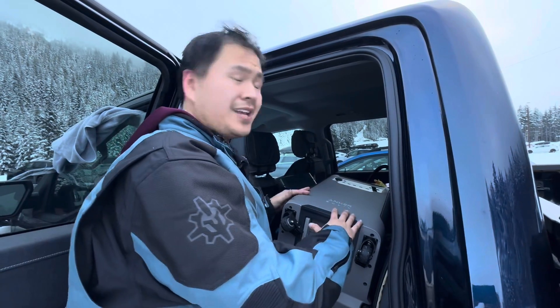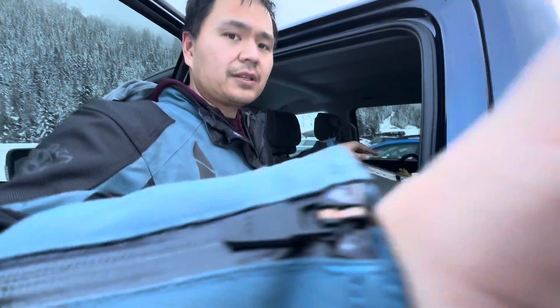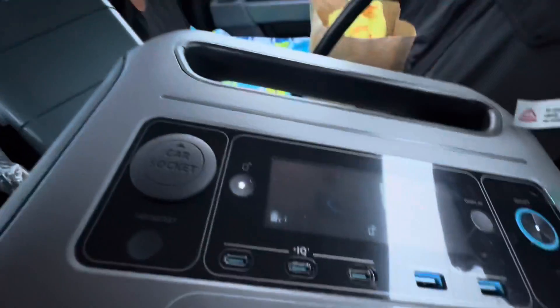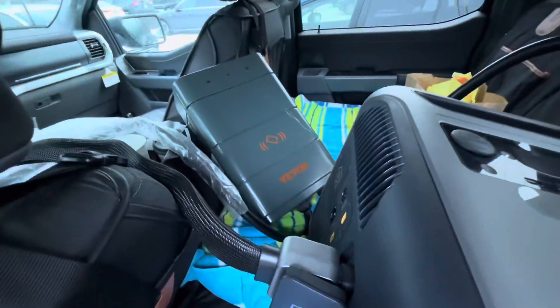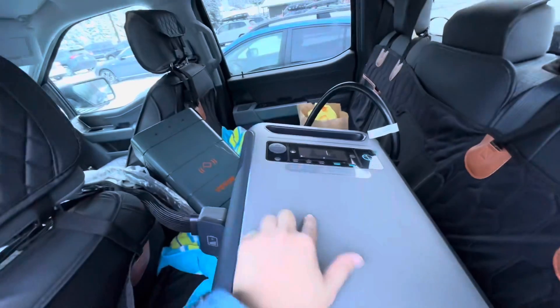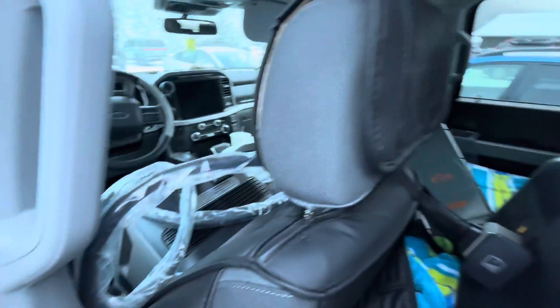I lost 12 miles driving this truck up to Crystal Mountain Resort in the PNW. This setup with the Anker Solix gave me 12 miles back. I was able to drive two hours there and two hours back without stopping at a public charger. Public charging costs about 50 cents per kilowatt at many stations versus 13 cents per kilowatt at home. To charge this fully at home: $8. To charge at a public station: easily $30 to $50. So in many ways, it does save me money — probably $20 to $30 in savings every time I discharge this battery completely.